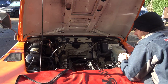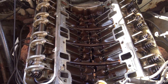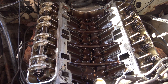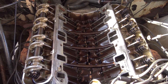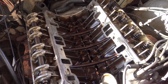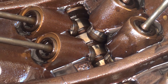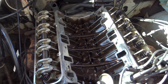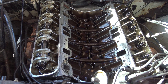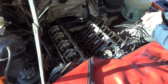We just had a look on the odometer and we're assuming 51,000 miles is the correct mileage. This engine was built in 1988 according to the date stamp on the rockers - so 31 years old, looking this good inside is remarkable. It does show its low mileage and has probably been serviced at regular intervals. The camshaft is just showing signs of discoloration. We had all of these lifters out and they're all actually perfectly flat on the bottom still, so it's in good shape. It'll probably be okay for a few more thousand miles before camshaft wear starts to set in.